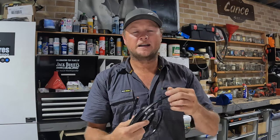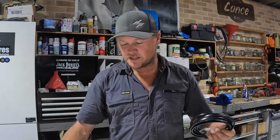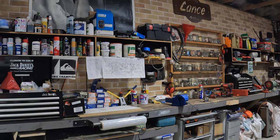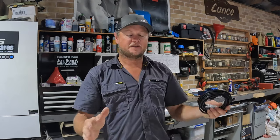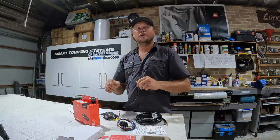Make sure you don't skimp on the wire — follow the book because it does use a fair bit of current. Use the correct size wire: three square millimetres or 12 gauge minimum. This wire I've found is actually 4.5 square millimetres, so bigger is always better than smaller. Let's get in and put this Tow Pro Elite in a really old truck.